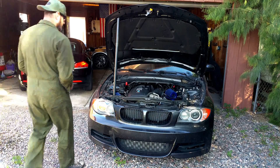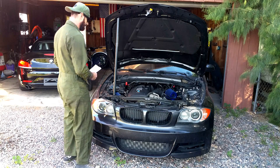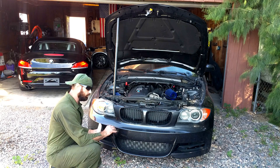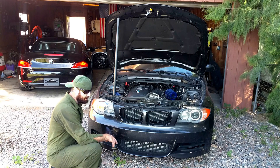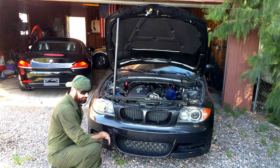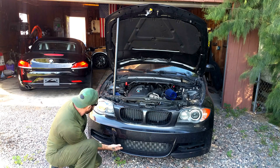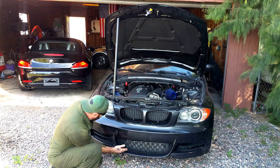I'm going to do a quick video on just the basic upgrades for bolt-ons on your N54 engine. The first thing you want to get would be a nice intercooler. You don't want to go too crazy — it just depends. If you're going to go big turbo, then get the RSF seven-incher, or you're always safe with the six-incher. The only problem with the six-inch core ones is usually they just have two-and-a-half inch in and out, which you can make big power with, but I would rather have the three-inchers.